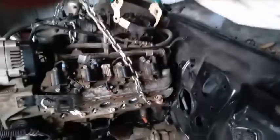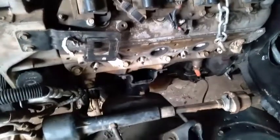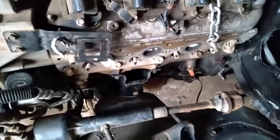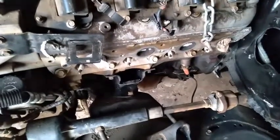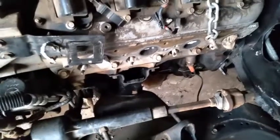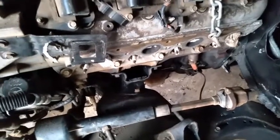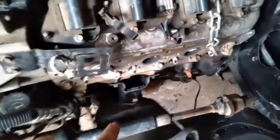Oh, well, I got the motor all put in here. I did build an engine mount. It turned out really nice, but I've decided to go with something with a bushing in it. These are solid mounts, and I don't want this thing to rattle like crazy. So, comfort-wise and stuff, I think it's going to go better, but they won't last as long. So, I just did one prototype. I didn't do one on the other side. I'll come around front here.